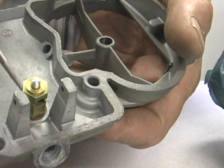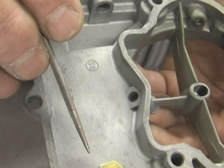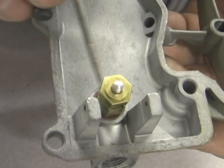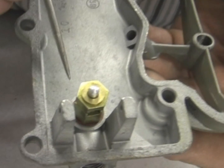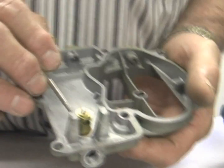If you haven't tightened up the seat pretty good, it can back out just a little bit. I don't know if the gasket swells or what's happening, but if the seat's loose, you're going to have fuel running all the time. Even after you shut off the car, there's a little bit of pressure left. So you want to check that.